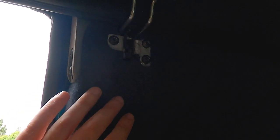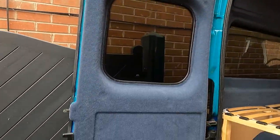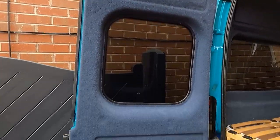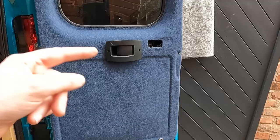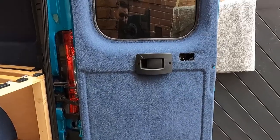Another thing I've taken care of while everything's been slackened off is I had an issue with the rear doors where they didn't shut properly, so I put the bolts back in, didn't fully tighten them, pulled the door to and made sure it was locking nice and tight, then tightened everything up — and that's all sorted now. While I'm waiting for that carpet to arrive from eBay, I'm going to turn my focus to sorting out the inserts. I need to pop out, pick some wood up, cut some templates, cover those and then screw them in place. I've decided to leave the carpet as it is underneath, and if I ever need to access behind there I'll just remove the insert, cut a slit in the carpet and poke my hand in.